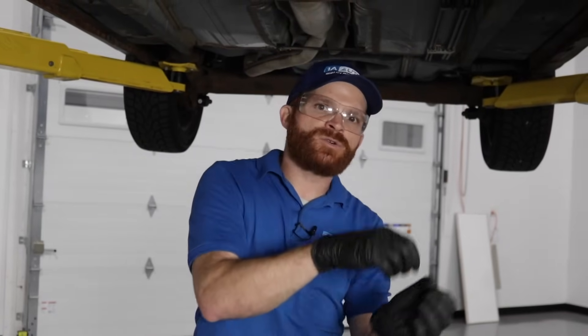Generally, if you have an exhaust manifold leak, you're especially going to be able to hear it when the engine's cold. The reason for that is because when things are cold, they tend to contract — especially metal. So if you have a discrepancy in the metal, such as a crack or an imperfection, the exhaust fumes and noise are going to be able to make their way out through it. Once the vehicle warms up, the metal's going to expand and kind of close up that crack. So you might notice that your exhaust leak tends to go away after you've driven a couple of miles.